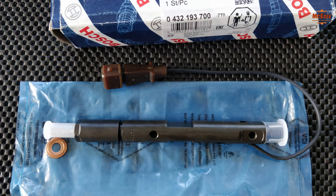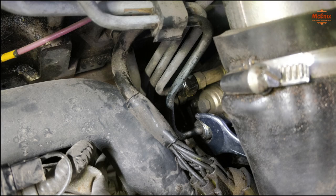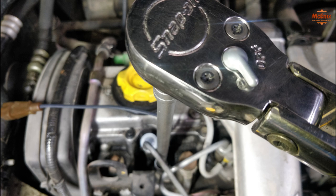This means that we have to put the new injector in. For that we also need a new washer that in this car is a specific one, be aware of that. We are going to use a 15 and 17 wrench to undo the feed diesel line onto the injector, same process to reassemble the new one. For the feed line out the injector pump we use the 17 wrench, and we only need to free a little bit this one in order to allow the pipe to move on the other end to be able to free the injector.